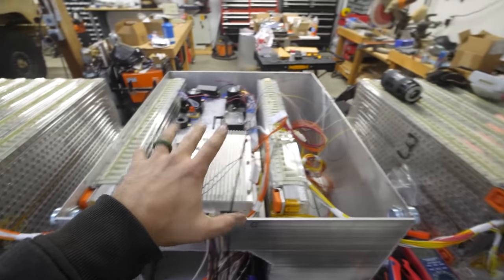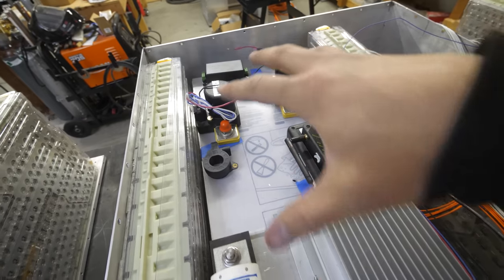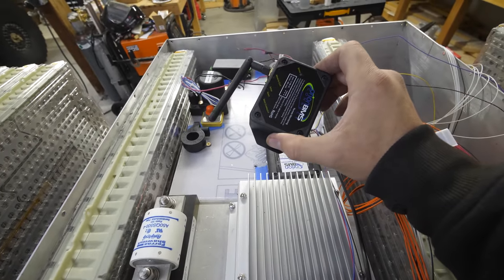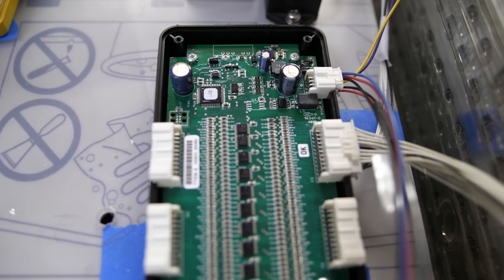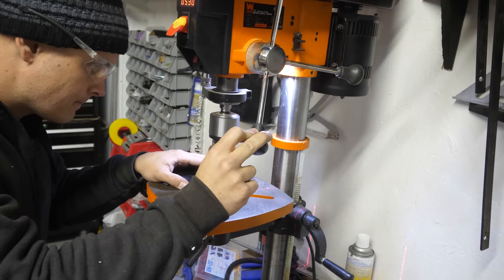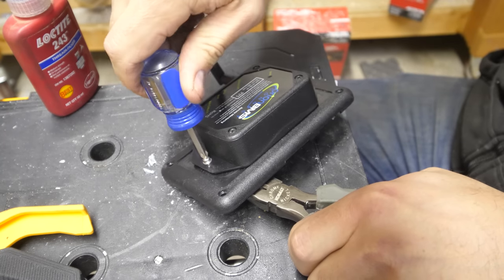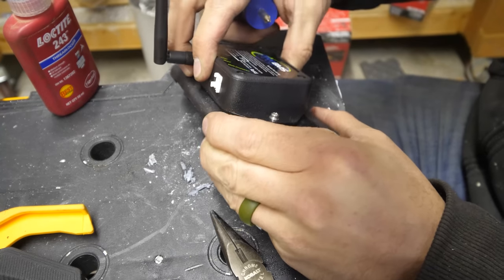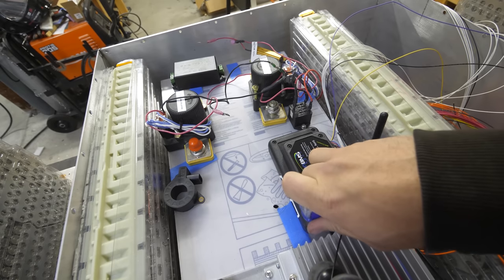We have the passenger box, driver box, and center box, with all the high voltage components tentatively laid out. There's a Wi-Fi module that will allow my computer to connect with the system so I can read voltages and temperature in real time. Since there's no space, I'm going to take off the top of the thermistor box, drill some holes, and mount the Wi-Fi module on top using isopropyl alcohol to remove the adhesive, a drill press for the holes, and Loctite with two little screws. Now it's unconventionally mounted, but hopefully allows wireless communication with the system.